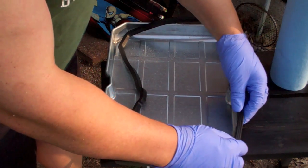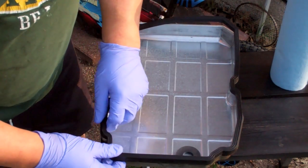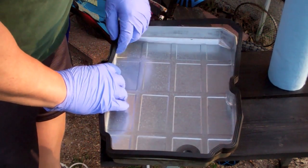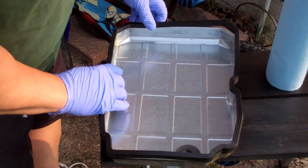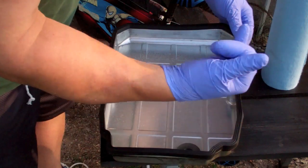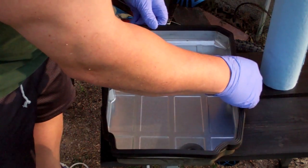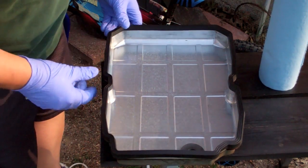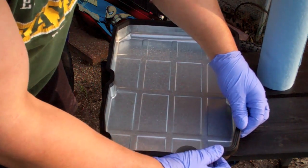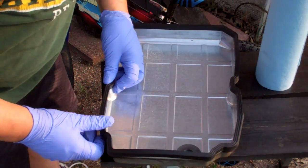The Dodge gasket is unique in that it kind of fits over the edge. On other transmission gaskets I've done before, there's kind of a flat edge and it just sits on it and then the bolts go through. So this one fits over it, and there's the 6 retaining bolts that have like a little tab on them that presses against here.